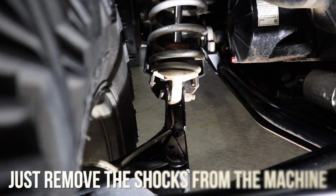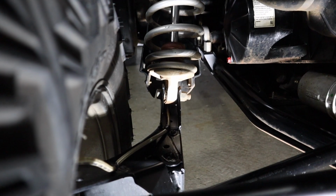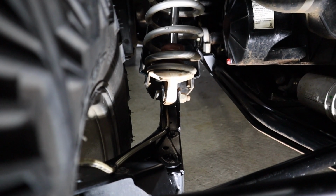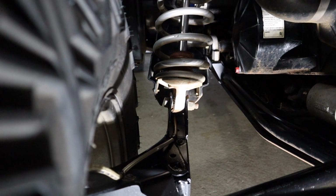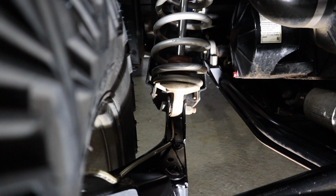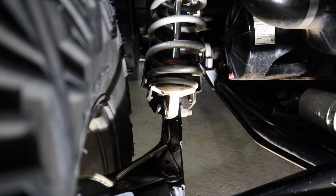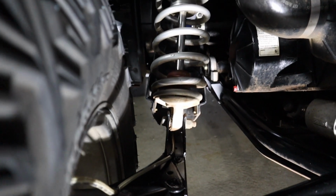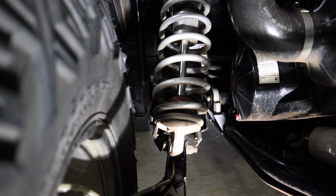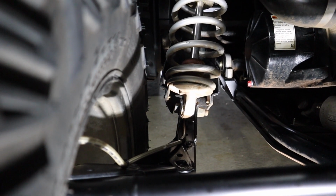You have to pull the shock apart. When you pull the shock apart, there's an O-ring that pops off. You have two little spacers that slide out. What I normally do is just wipe a little bit of grease in those, reassemble them, and then get everything bolted up together. And I only maybe need to do that every 2 years. That's enough grease to keep those from squeaking for a long period of time. If you haven't done it, I highly suggest that you look into it.